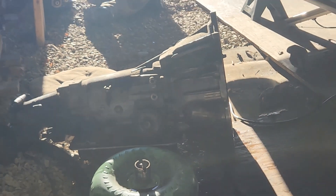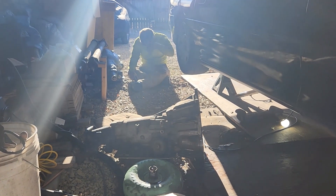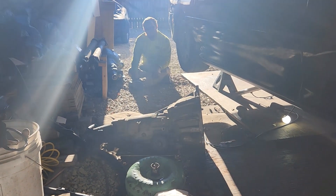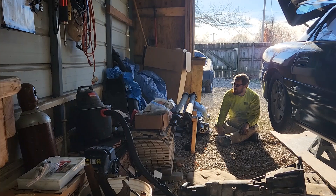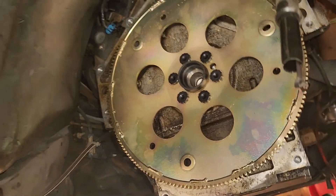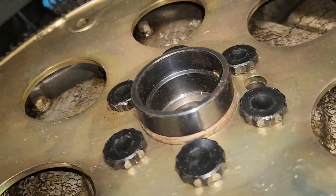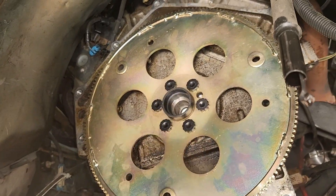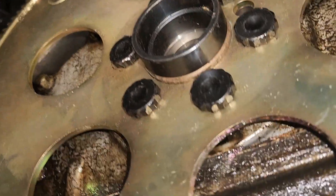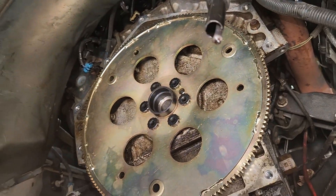His dipstick seal fits too. What we still need: torque converter bolts, a dipstick, and a driveshaft. Hopefully Christopher's driveshaft might work. I got the flex plate on there with the adapter for the turbo 350 — I just took a piece of wood, laid it on there, and hammered it up onto there. It slides it out and gets it flush.